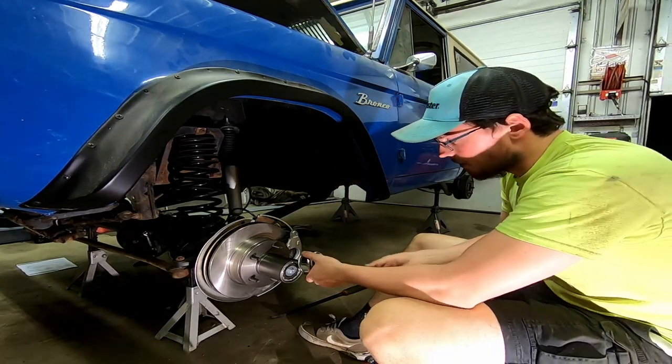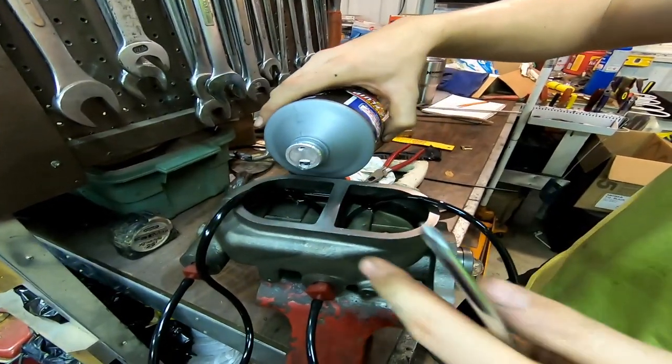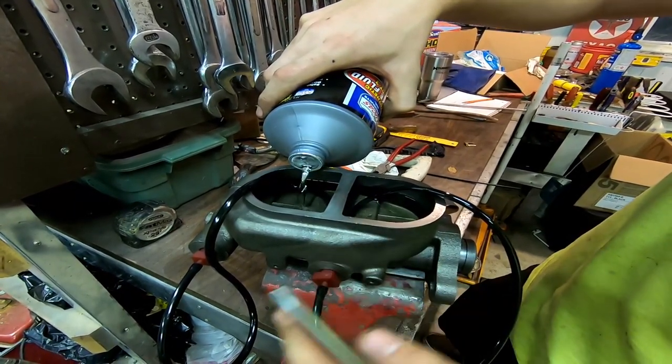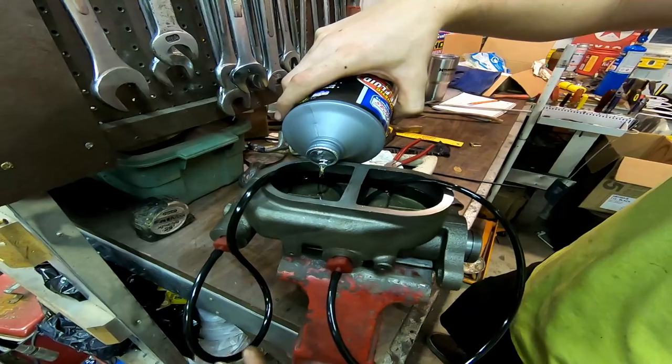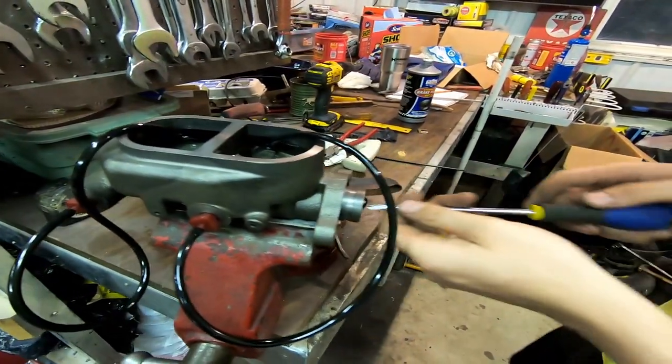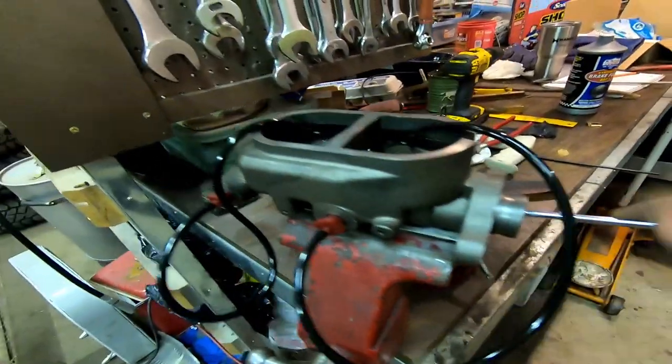The Wild Horses kit says that for some of them that have this bolt hole drilled in already, you can use this instead of a snap ring because it changes the depth of the lock ring that would be in there. I got the nut on and I stuck a pry bar in the back of the U-joint so that I could get that tight without it spinning. The last thing I gotta do before bleeding the brakes is put this thing on. Basically set up here, get these little cords that wrap around, go in here with a screwdriver, put on a vise, and you just push.